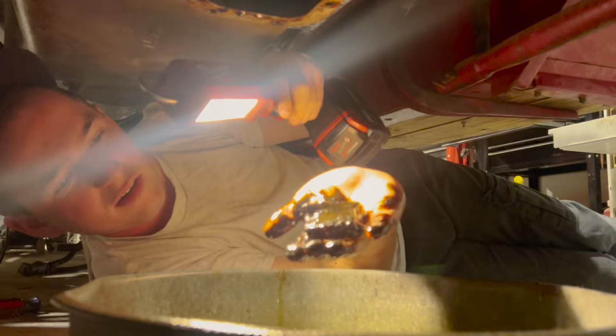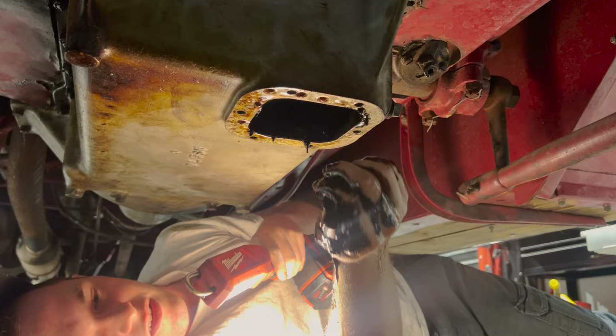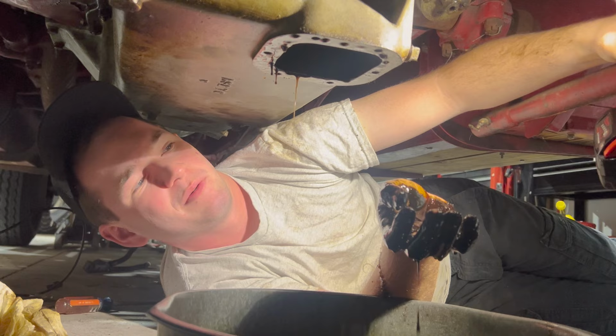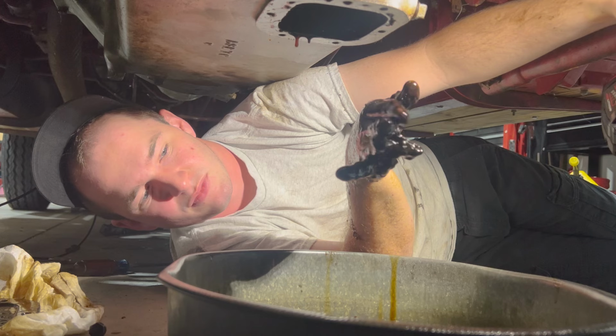Oh my god. What the? Already? Yeah. Okay. We're pulling the oil out of it right now. Look at that. Yuck. Yep, pan's coming out. Well, now the pan's got to be dropped, so we have to add that to our list. If it ain't one thing, it's another, but we definitely need to pull it. When you checked the oil, everything looked good because the previous guy changed it, but evidently he didn't drop the pan. Yeah, you can literally just scoop out chunks. The whole bottom of the pan's just solid.